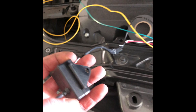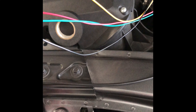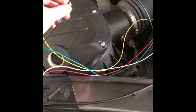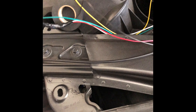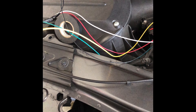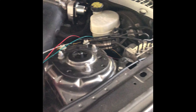For the wiring, you've got your sending unit with a red, white, and black wire. The white wire, according to their schematics, is the sending wire that goes to the back of your gauge, which is a green wire — it doesn't make a lot of sense, but that's how they have it. The ground wire I'm choosing to run into the cab as well so I can put all the grounds together nice and clean. The red wire is going to be the accessory power for the sending unit. That's all going up into the cab. This yellow wire is also going up into the cab — that is going to be the constant power, which I'm going to run over to my battery, though you can run it to any hot wire that's always 12 volts.